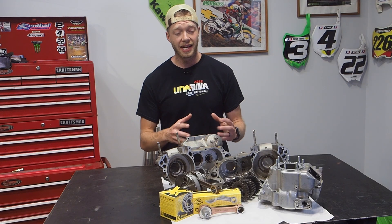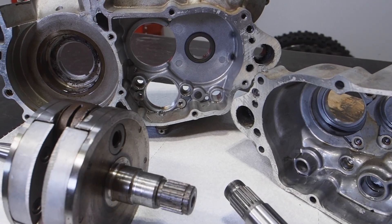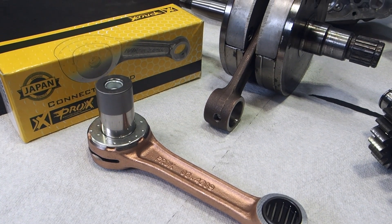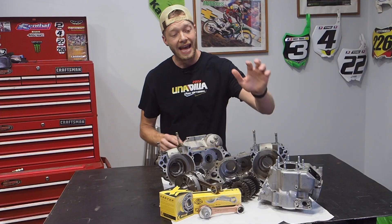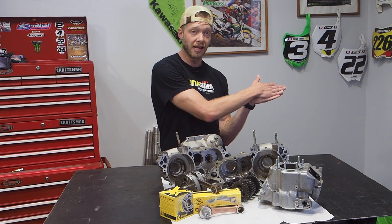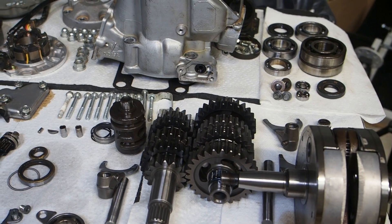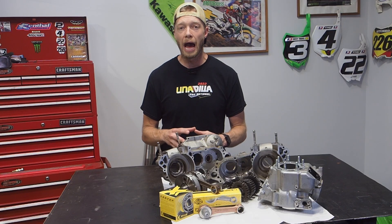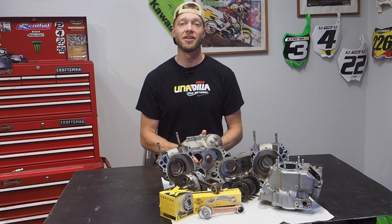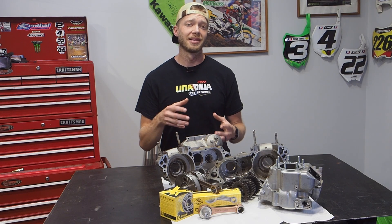That's going to be the complete teardown of my 1999 KX250 engine. What's happening next? I'm getting a ton of vapor blasting done by Tyler from Motor Resurgence — he's going to blast these cases and make sure they look brand new. Millennium Technologies is getting a big box of parts: the crank with a new Pro-X rod and bearing, the transmission for isotropic micropolishing, and the cylinder for a fresh Nikosil replating. Once I get the cylinder back, it's going to be sent off to Pro-Circuit, and Mitch Payton himself is going to be touching up those ports, giving this KX250 a little extra oomph. Now that the bike and engine are completely torn down, this is where the nitty-gritty work really starts to happen. If you want to catch more videos, head over to my channel, Greg Hitchcoe, for in-depth detail, or catch the highlights right here at Whiskey Throttle Media. I really appreciate you guys watching. As always, ride hard, be safe, and we'll see you in the next video.